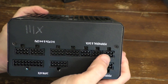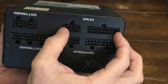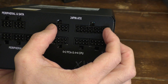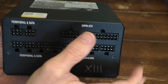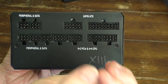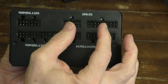But that brings me to a problem, because these things are not color-coded. The funny thing about Corsair is that this right here represents the 24-pin plug, and it actually says 24-pin ATX. So this is 24 pins. However, if you count the number of pins, it actually adds up to 28 pins. This is not consistent with every Corsair unit, but it is common that you get 28 pins in a 24-pin plug. Now the other end of the wires after you plug in this — the other end is 24 pins. However, the plugs that go into this power supply are actually 28 pins.